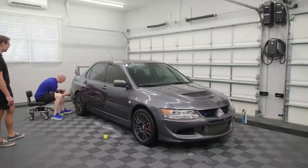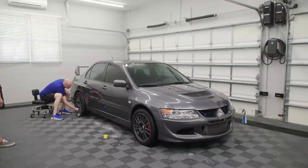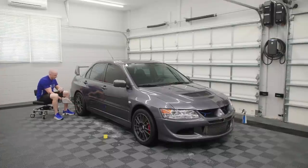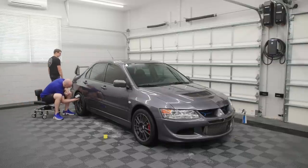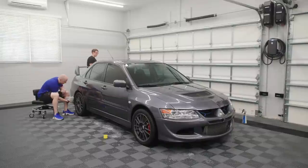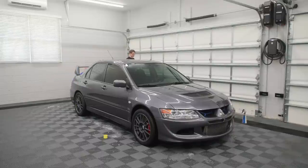Well, let's be real. My Golf R will go through a water pump and thermostat housing every 20,000 miles. Well, but that's real. You know, high pressure fuel pump in an N54, same thing. I didn't believe it at first. My 2015 has a different design than the rest of the Mark 7s. So mine lasted 90K miles and still factory, and we swapped it out as preventative maintenance. It was already leaking. So the original ones, fine.